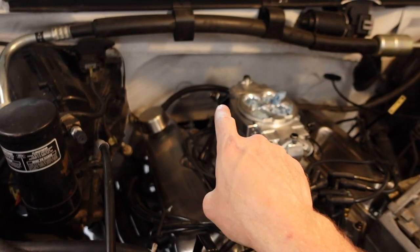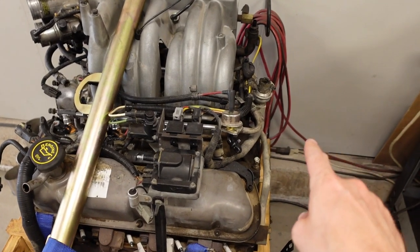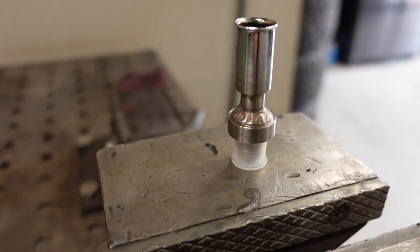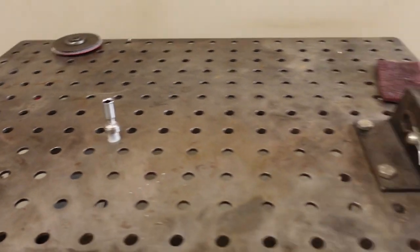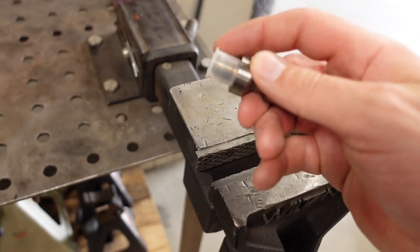I've got to make the connections to the factory fuel lines. Ford uses — I believe they call it a spring lock style connector in this year — and they're a really weird connector on the F-150, a different size than some of the Mustang ones. I spent a couple hours looking for adapters to go from that style to an AN fitting and could not find one, so I built my own. I chopped off the ends of the fuel rail — the two connectors, feed and return — and bought some Dash 6 AN weld fittings that were stainless steel and just welded the two together. That is the feed side and that's the return side, and these will allow me to plug into the factory lines and install a regular Dash 6 AN line. If you can't find what you need, sometimes you've got to make it.